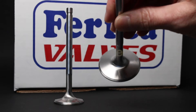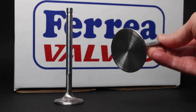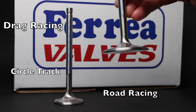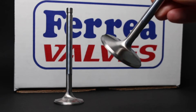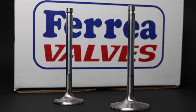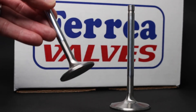Now let's take a look at the 6000 series. Also three simple tips to remember when choosing these valves. Great for circle track, drag racing, and road racing applications. No turbochargers, superchargers, or nitrous. Maximum spring pressures should be kept between 250 to 300 pounds on the seat pressure.